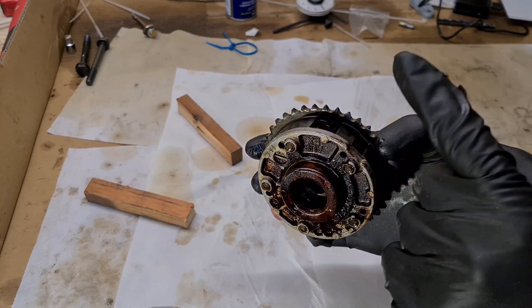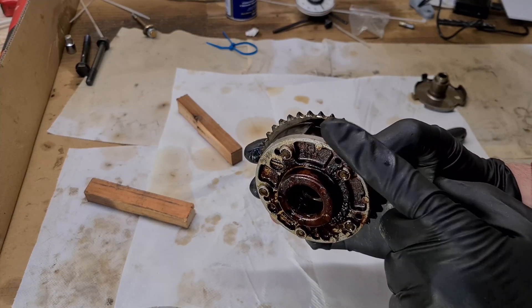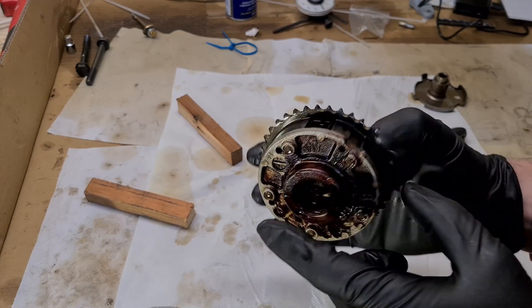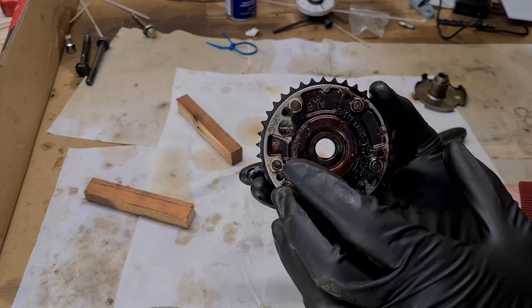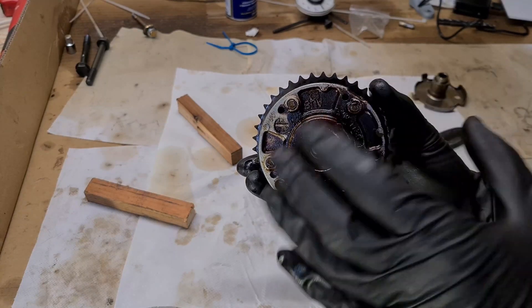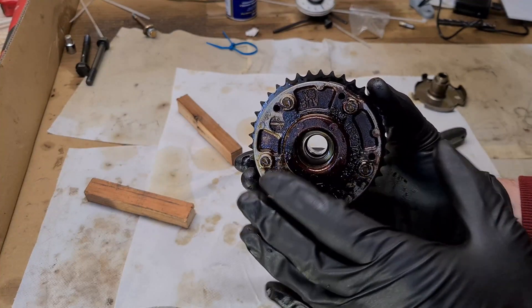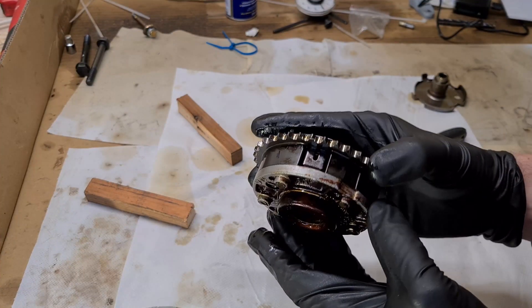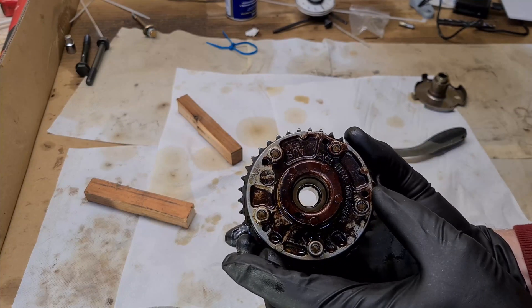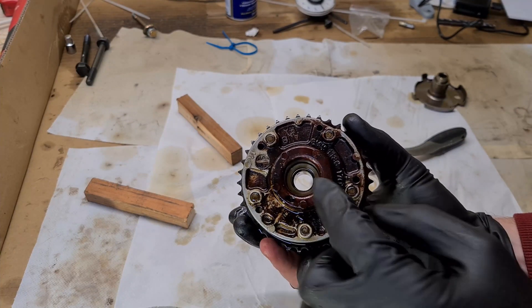I think that's because the units are not locked and the pin is stuck open. This usually happens intermittently — one morning you have the rattle and the next you don't. That's why it's a bit hard to diagnose. So I'm going to open it up and see what's going on.